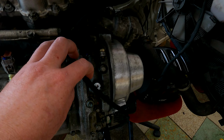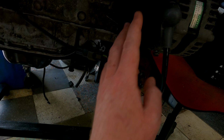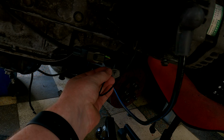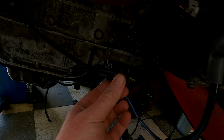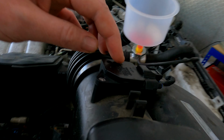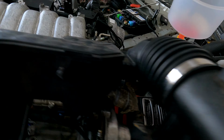Again, coming straight down here, you've got your plug onto your throttle over there. Coming down here, you've got your plug onto your alternator. You've got your low oil level sensor that'll go into the front of your sump over here. We're using LS430 engines, that's why we've got a mid to rear sump if you want to call it that. You've got your oxygen sensor, which also clips onto a little clip underneath here if you still got that. And then you've got your MAF, which obviously we've got an LS430 air box that we're just using to test all the MAF on here.